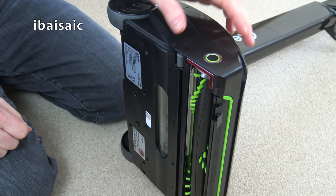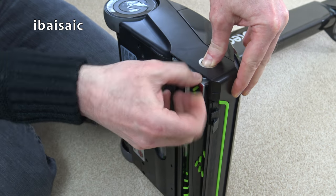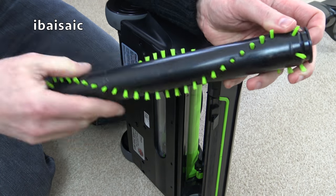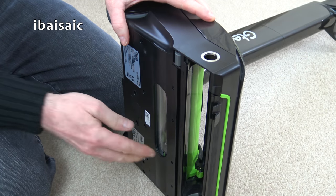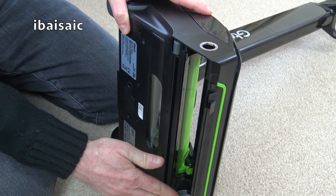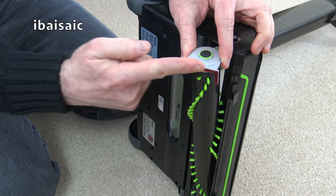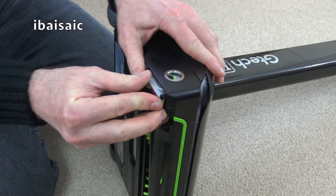To clean the brush roll, place the Air Ram on its side, press down on the button and remove the brush roll. You then have full access — use scissors to cut along hairs wrapped around it and pull them off. Also make sure the area where the brush roll sits is clean. Locate the brush roll at the bottom with the little velour strip uppermost and push it back until the button pops out through the hole.